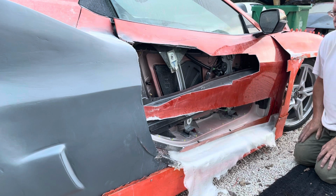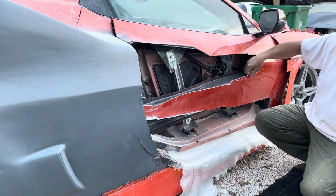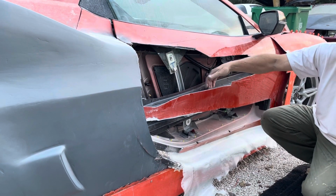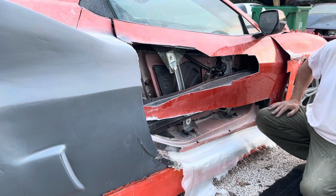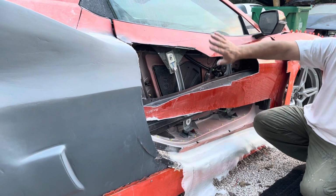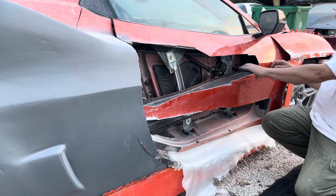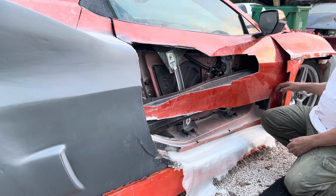But before I got going, I'm going to show you what I worked at. The other thing is, if you look, here's the door structure right here. So if you look, I essentially cut off pretty much everything that attaches. Now they've got the factory bonding compound adhesive that they use here. So ideally what I could do is come in here, cut this adhesive, remove it, and then replace this door panel with my door panel. Once I get a final door panel by making the combination of the two and then blending them together, the next one I do could be a solid door panel that I literally just come in, cut out the factory door panel exactly where the factory attached it in the glue spots, and then replace it with my own glue. I'd have to have some kind of clamps or fixture to make sure that everything stayed butted against it, but I'll worry about that when that time comes.